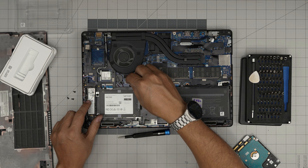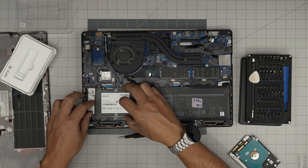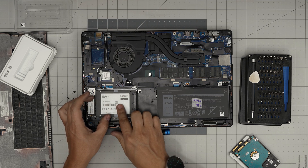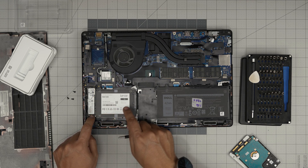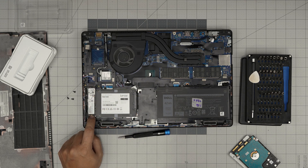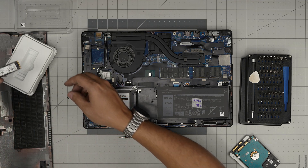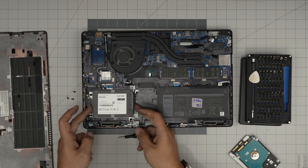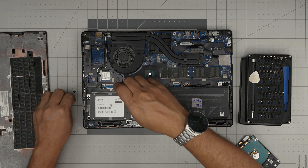You can also keep both drives simultaneously — route the SATA cable underneath and still plug in the 2.5-inch drive to have a four terabyte SSD or two terabyte mechanical drive alongside the NVMe. You just need to put double-sided foam tape under the NVMe since the screw holes won't match. I'm pulling it out just for demonstration, but we've done this before with no problem. Put the 2.5-inch drive back and reinstall the caddy screws — four normally, three in this case since one is missing.